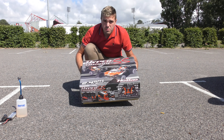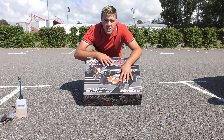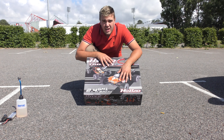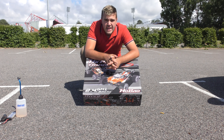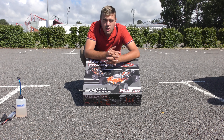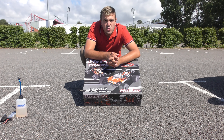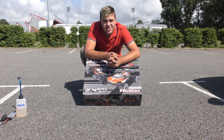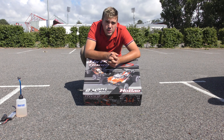So that's what the user manual says. I'm going to take you over to the car now and show you the car idling. What you're looking for is it should be running on a rich setting as the manual states — two things with that: firstly you might notice a little bit of fuel spitting out of the exhaust pipe, and also a little bit of blue smoke as well. My car's still on its first tank, let me take you over and show you what it looks like.